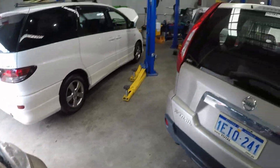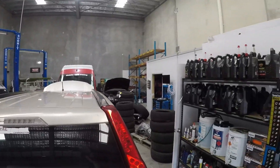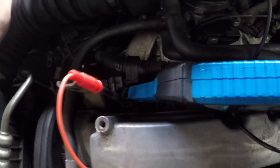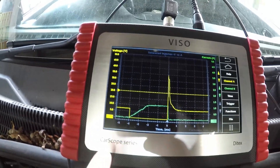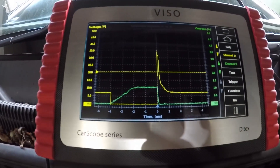We're quite busy today. I couldn't get my Pico trolley over here so I've got the Viva on the bench. What I've done is gone to a known good — number one — doing voltage versus amperage. I've got an amp clamp around one wire and the voltage on the control wire. As you can see, that is our known good: a nice clean ramp up on the amp line and a great looking injector waveform.